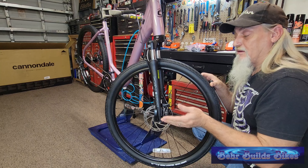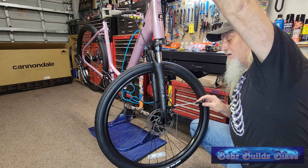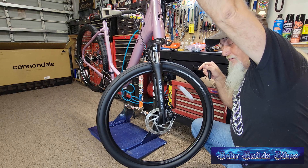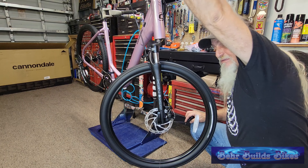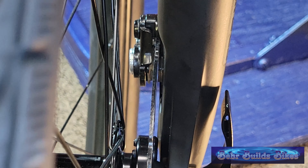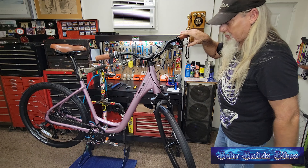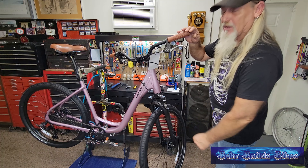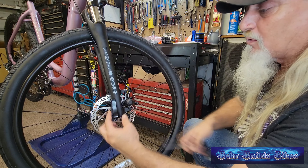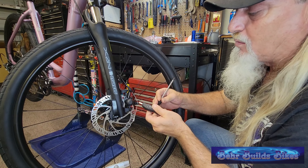Now that we know our wheel is centered in the fork, we're going to adjust our brake. We've already loosened up the calipers so it's free-moving. One way to do this is by squeezing the brake lever — that sets the caliper in place and you can just snug up the two holding bolts. I like to use a long allen wrench; it gets in there better. You can still hear a little rub, so we make minor adjustments to get rid of that and fine-tune the cable. We're looking for about a half-pull before the wheel is completely stopped. Then we trim off the rest of the cable and put a cable crimp on it. Once you're happy it's not rubbing, everything is aligned, and the crimp is on, go back and tighten everything down so nothing moves and the cable isn't going to slide through.